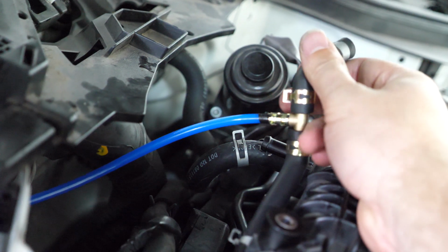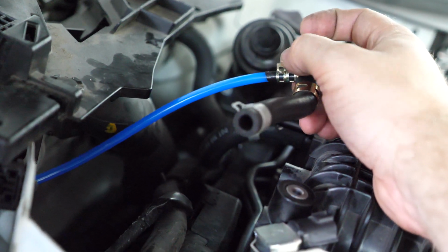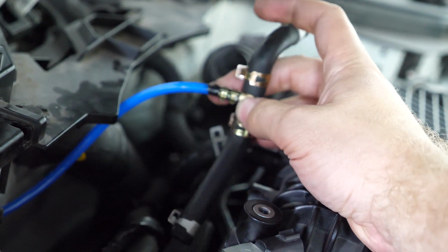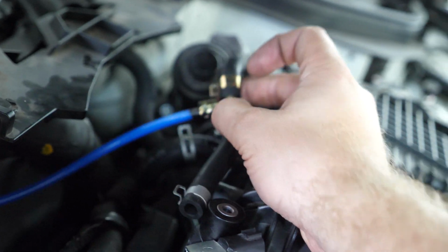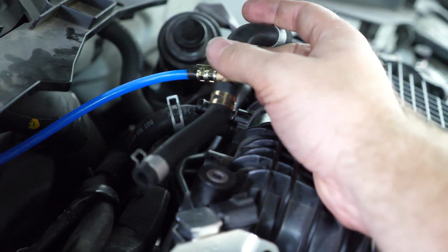So I've got that boost reference line in there now. We can see it with a couple of hose clamps. These are really tiny 6mm hose clamps. I'll leave a link in the description below to the assortment box that I got these in. But you can see this little piece of electrical tape that I've had to put on there as well because these hose clamps didn't sit tightly on the line. Ideally, your lines should fit on there tightly by themselves and not even need hose clamps. The hose clamps are supposed to be secondary.